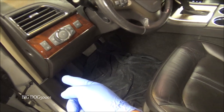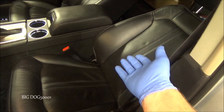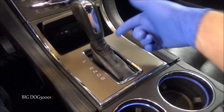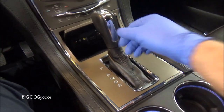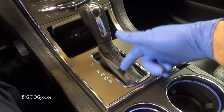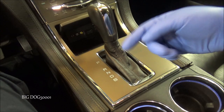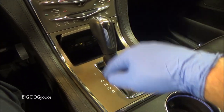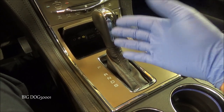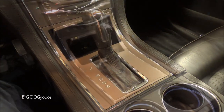First thing we'll do: apply the parking brake, which I did, and then we want to put the seat all the way down and back as far as it'll go, just to get out of the way — both of them. Now the part that failed is a switch that's part of this selector knob assembly. Luckily we can just buy the switch and replace just the switch. On many models you have to replace the whole assembly, which can be costly and a lot more labor involved.